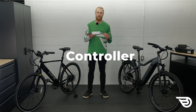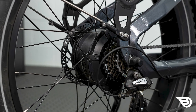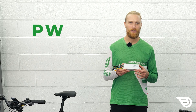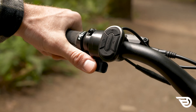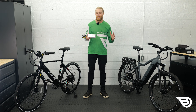Let's talk about your controller. This device is the brain of your e-bike and it's connected to your bike's battery, motor, and if present, your throttle. It controls the movement of power from the battery to the motor by pulsing on and off very quickly. This function is known as Pulse Width Modulation, or PWM. It prevents excess stress and overheating of your battery, as well as ensuring that your motor doesn't overheat. What this means is that you can't instantly slam the throttle from a dead stop to full bore. The controller sets a limit for how many amps are allowed to flow to the motor — this is known as the controller's maximum amp rating, and as we'll soon see, this radically affects how much power is available to you.